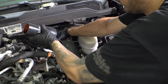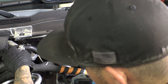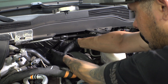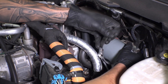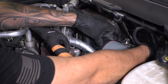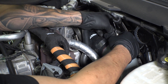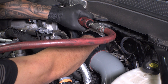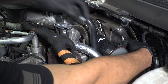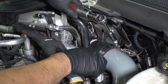Now it's time to connect the driver's side boost tube to the turbo outlet. Find the turbo outlet hose and slide it onto the boost tube. Although there are different ways of doing this, we recommend opening up the two 3.5 inch T-bolt clamps and sliding them over the hump hose once the tube is inserted. Tighten the clamp down to about 5 foot-pounds, that's 60 inch-pounds.